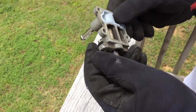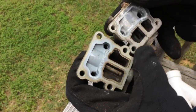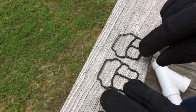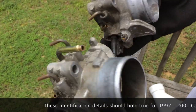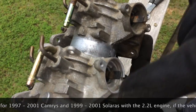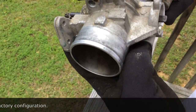Here's a disassembled idle air control valve for a California emissions vehicle, and this is one for a federal. You can clearly see the difference in the air intakes — the federal is smaller, the California is bigger. The gaskets are also different sizes accordingly. Looking at the throttle bodies themselves, same thing — this is the California, this is the federal. Another way to tell the difference when you're at the salvage yard without disassembly: look at the very top where the Toyota branding is cast in. Federals have a round hump on the casting; Californias have a square hump. That's a quick way to ID them and get the right one.